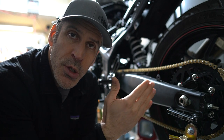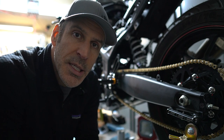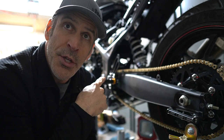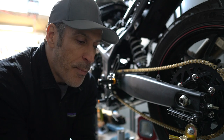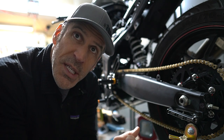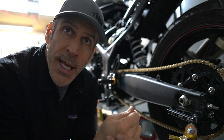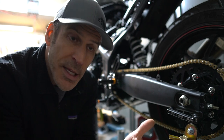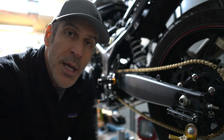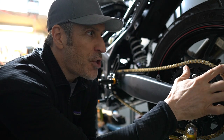When adjusting the wheel, I take into account that after a few hours of riding I'll need to push the wheel back as the chain stretches. I know for a fact that with an 18-tooth front and 55-tooth rear sprocket I'll need the chain to be 142 links. When I switch to the 57-tooth rear and keep the same 18-tooth front, I'll need to change the chain to 144 links — this is why I got two chains originally.